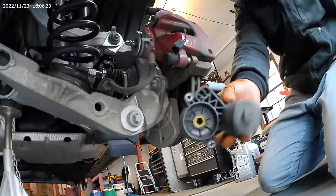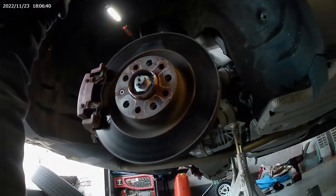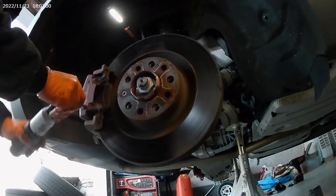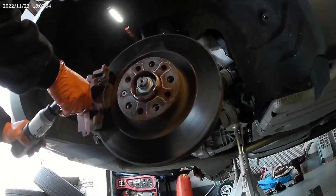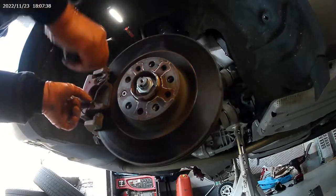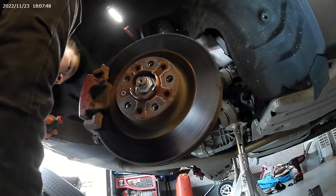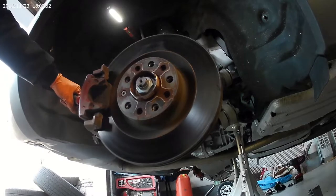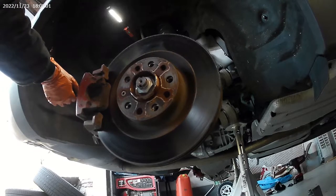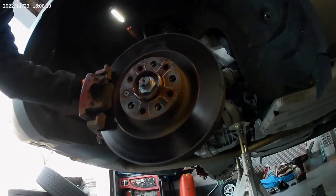Pretty simple right here. Now let's switch to the front side of the caliper. Get the caliper retaining clip off. The next step I like to do is retract the caliper — that's just by sticking the pry bar into the rotor, since everything's getting replaced anyway. As you can see, that's fully retracted, so now we can work on the caliper slides.